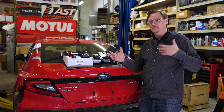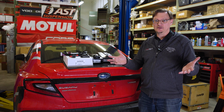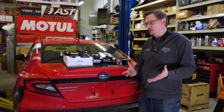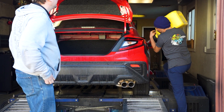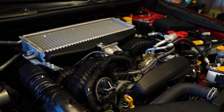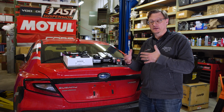That's a really handy feature, especially if you don't always have easy access to FlexFuel — if you want to do road trips where you might not have access to it. Why would you run FlexFuel or E85 in the car? It's an alcohol-based fuel, ethanol. It's basically like running race gas all the time. It has much better cooling properties, it's much more detonation resistant. In a high compression turbocharged Subaru engine, there are a lot of benefits to running E85 if you can do it.